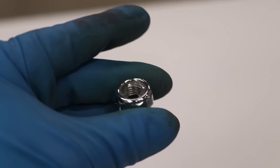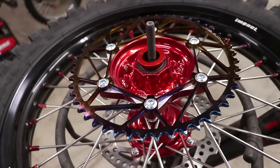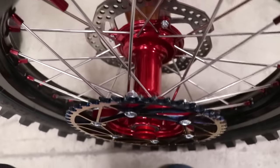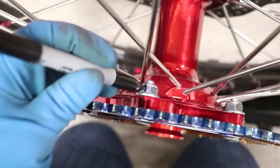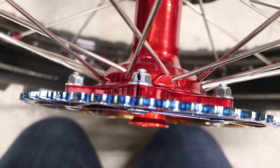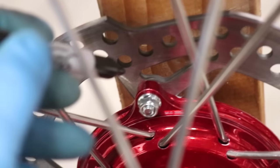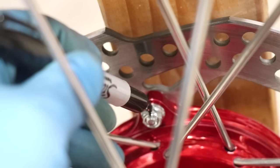These bolts already came with Loctite in the threads from this bolt hardware kit, and the nuts are a locking style. On the end of the nut there's a little locking mechanism that helps keep the nut in place. Between the Loctite, the locking nut, and torquing these — I'd recommend torquing them to about 30 foot-pounds — they should stay in place pretty good. To make it easy for keeping an eye on these sprocket bolts, take a sharpie and mark the nut, make a line on the nut up onto the hub. If you notice those lines aren't lining up anymore, that means your nut is backing off. I'll do it for the rotor bolts as well. You can also use a paint pen for this.